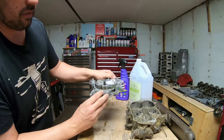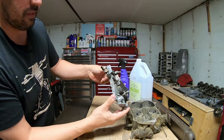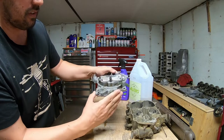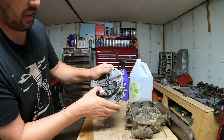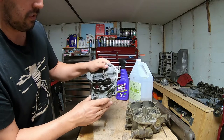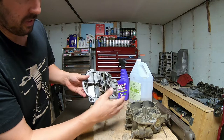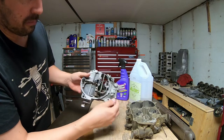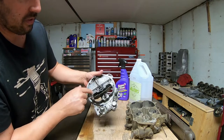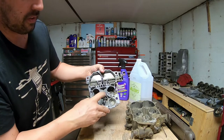The only thing the vinegar did was just take off that bronze coating they got on the carburetor. But it pretty well unseized a lot of parts. There was some stuff that was kind of frozen up a little bit, but the only thing I need to do is pop these throttle blades off and just give them another cleaning on the backside — same with these ones here. Like I said, more cleaning in here to do.